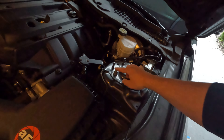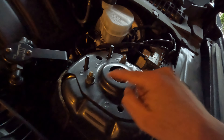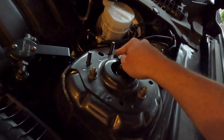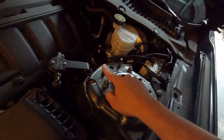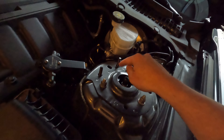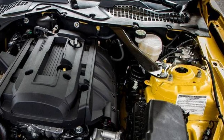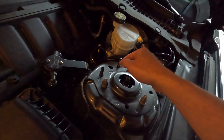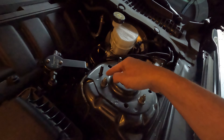Now we're on the driver's side and you might notice on this car there are only two nuts here that we'll need to remove. You also have two more studs here that the strut tower brace is going to utilize. Now if you have a performance pack — either GT or EcoBoost — you will have another chassis brace that connects to these two painted studs and you'll have two more nuts to remove. If you don't have a performance pack, don't worry about it. I'm going to remove those two nuts and then it's time to install this sucker.